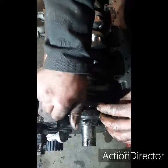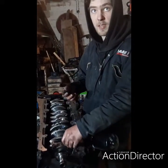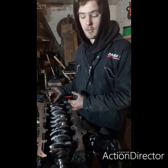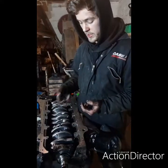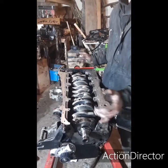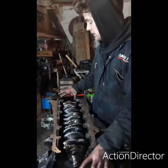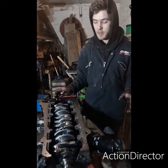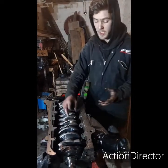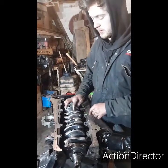I've cleaned everything up just to check there's nothing untoward, and also any bits of debris that might be in there — stuff that's collected over the years. It's best to clean it off while it's all in bits so you know nothing's going to get trapped in and no bits of rubbish are going to score anything. I'm just going to go along, do all of them, then torque them all up and that's the crank in. Next thing is to seal the ends, oil pump on this side, seal on that side, and it's away — bottom end pretty much done. Then I'll put the pistons in when I get the bits.